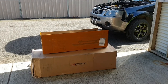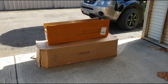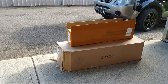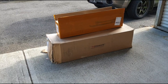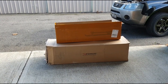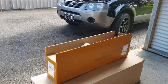So I sold that to him and tried to work around it. I was looking at catback systems for non-turbo Territory models, and all of them are the same from the early model all the way up to the SZ onwards. To me that meant they're the same shape and the hangers should be in the same area. So I thought maybe I can find an upgrade for a turbo diesel system, because it should be around the same shape up to the cat underneath the car. I picked up an X-Force system for $850, which I think will do the job - it's a bit of a gamble, but we're going to see if it works.